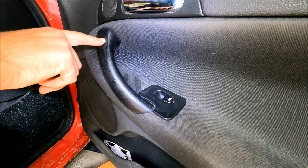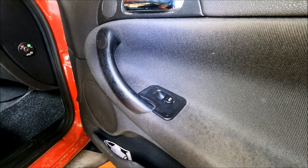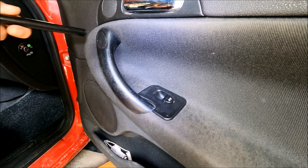I'm going to use a hot glue stick to remove this plastic piece without damaging it. What I'm going to do is heat up the hot glue stick with my heat gun, stick it to the trim piece, and let it cool down before I attempt to remove it.